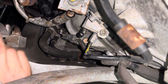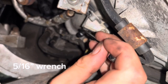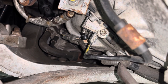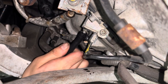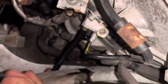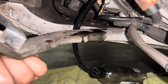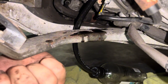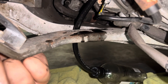You're going to twist this nipple - not all the way off but just to loosen it. For those of you doing this at home, this is a 5/16ths. It's good to put a rag under this so you don't get anything on your floor. Once it's loose, take your hose and your bottle and put it on the nipple. As you can see the hose is on the nipple and the bottle is over here laying on the rag, slowly dripping into that bottle. I'm going to get inside the car and press the clutch a few times to empty this - as I press the clutch you'll see the bottle fill up, draining the reservoir and lines of brake fluid.